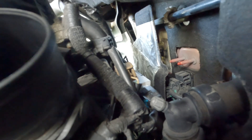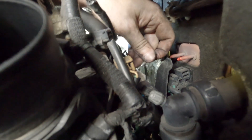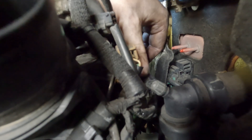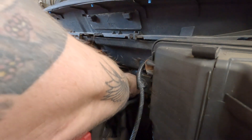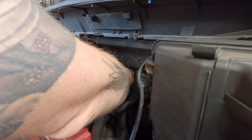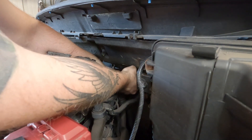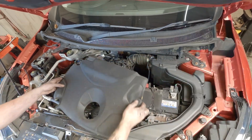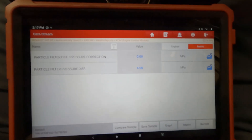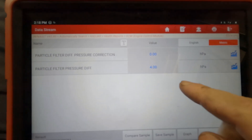We've put the electrical connector back on. I'm going to reconnect and then put the bolt in for the 7mm. You're going to have to feel everything because you just can't see it. That's slotted in nice — just make sure you catch it with your fingers first. Once you've caught it by hand, you can just final tighten it with the ratchet. Then slide this plastic pipe back into place.